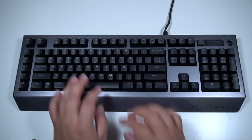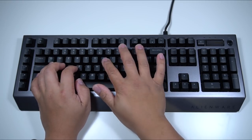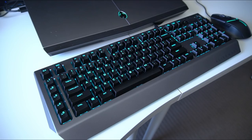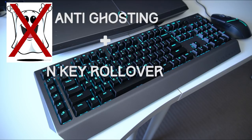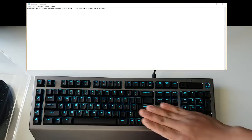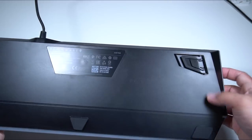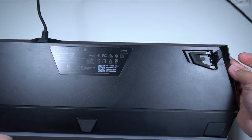When you type on the keyboard it's got a very tactile feel to it, because of the 45 grams of actuation force needed. What that means is when you press the key, you don't have to press it all the way down for the keystroke to be registered. It's also got features like anti-ghosting and N-key rollover on all keys, so if you press down on all the keys at once, they will all register in the system. You can adjust the typing angle using the three adjustable leg angles on the bottom corners, and the cable is braided with nylon, which is a very nice touch.